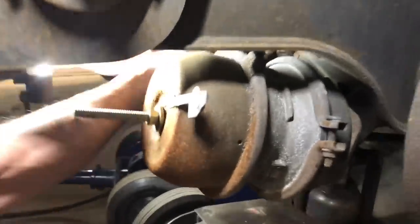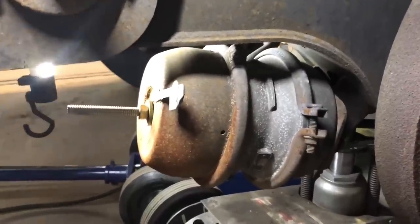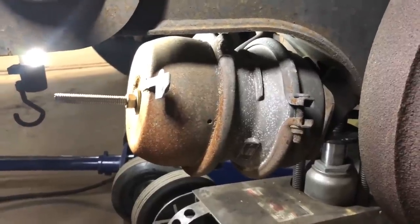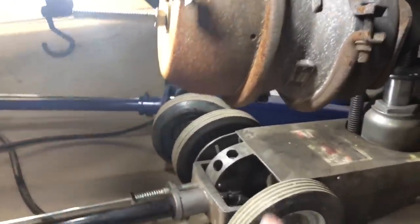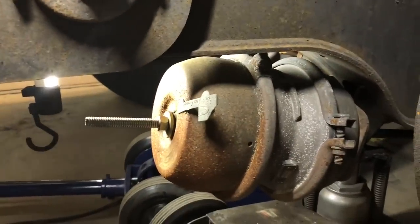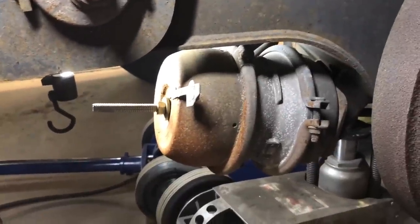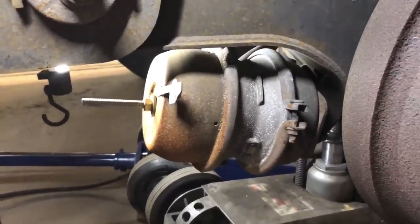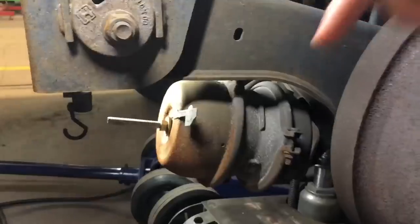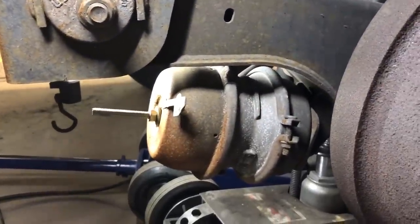Alright guys, so there you know how to do it. If you're not replacing the chamber yourself, the shop will go ahead and take the vise grips back off and give them back to you, and uncage your brake chamber. But make sure to put that bolt back in the hole where it goes — if you don't, the next time you have issues you're gonna be screwed. So there you go guys, that's how to get off the road in a pinch if you have a blown brake chamber. Like always, if you like this video be sure to hit that thumbs up and subscribe down below, and we'll catch you guys next time — y'all have a great one.